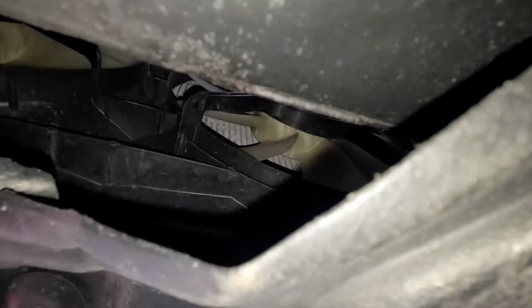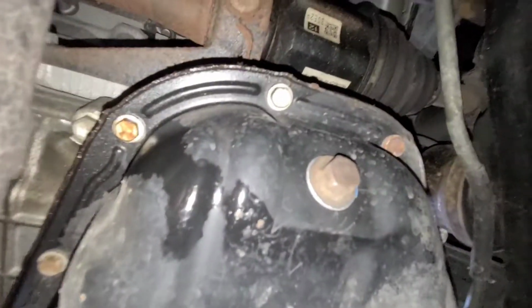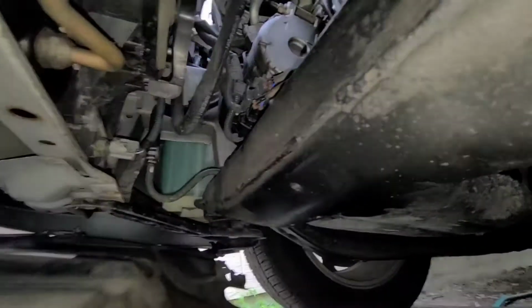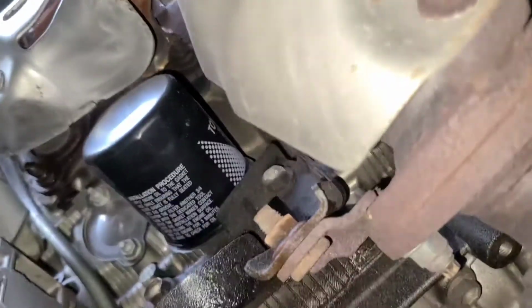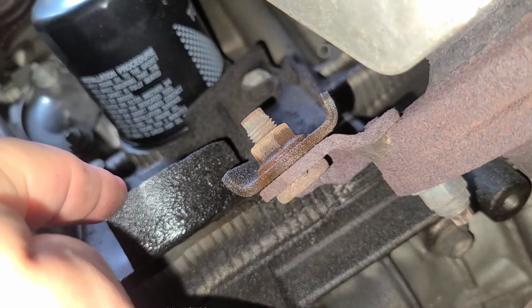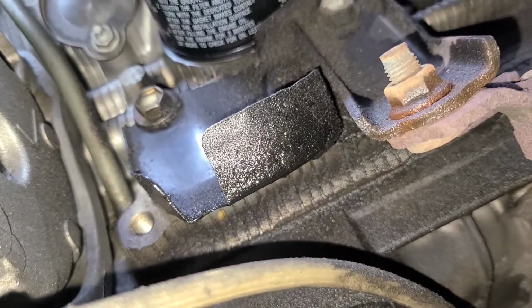Also, from dead center, the oil pan is straight back, right across from your passenger tire. All right, with the 2 removed, disconnect here, you'll have access to the oil filter. There's also a little catch can here. So when you undo the oil filter, drop the top into here and you can let it drain down and it will funnel right out of that spout into your oil pan. Let that drain for a little bit and then take it off and discard it.